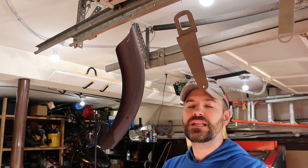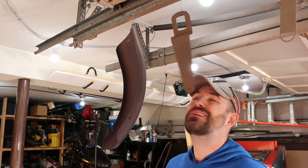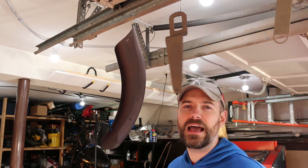Alright, so the fender is out-gassed. I'm going to let it cool down to room temperature, then I can start my powder coating — probably give it a good half an hour just to cool down. Alright, the part's down to room temperature. I'm going to check it over and make sure there are no last-minute imperfections or anything I need to clean, then I'm going to hit it with black.